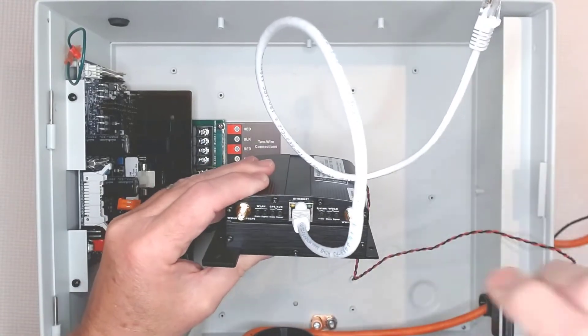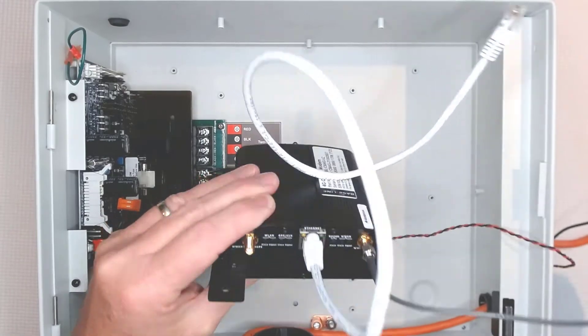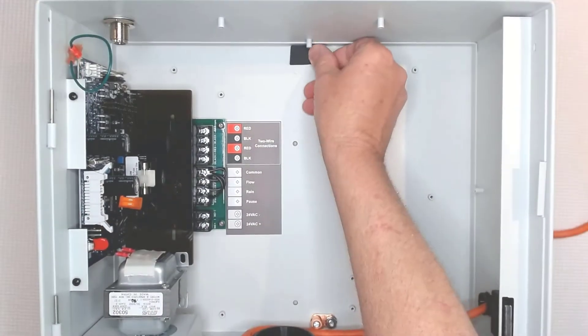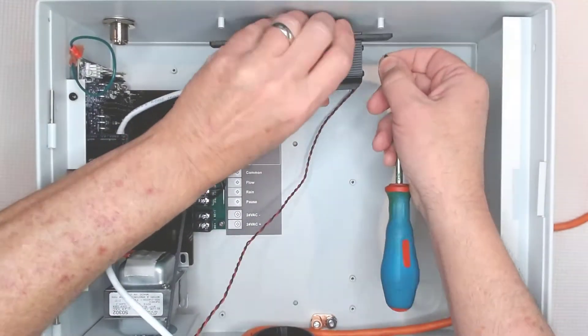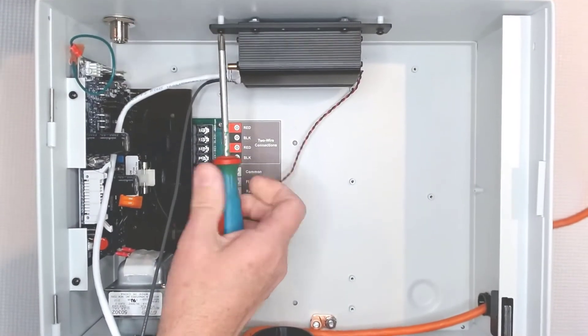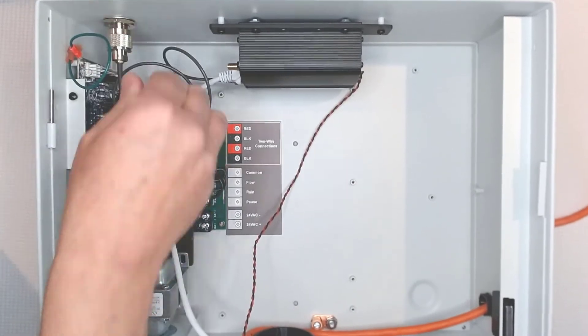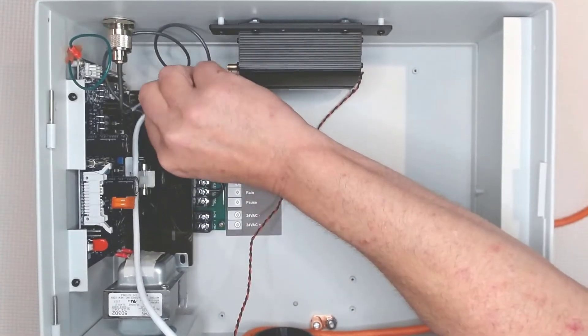Take the small antenna fitting and connect it to the adapter labeled WWAN main on the modem. Connect the modem with two screws to the inside top of the enclosure. The weather stripping material gives some extra support to the back of the modem. Connect the other side of the antenna cable to the salt shaker antenna — just snug it down.